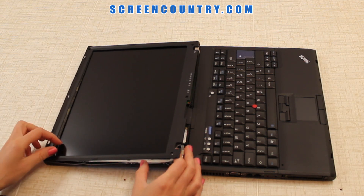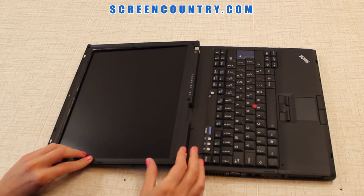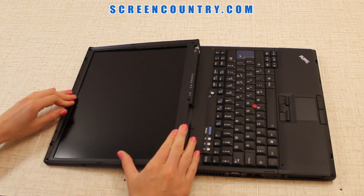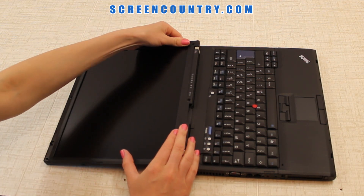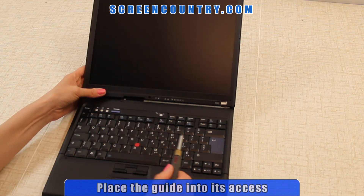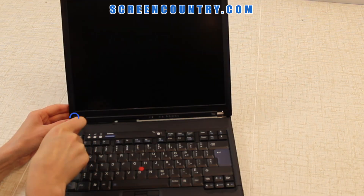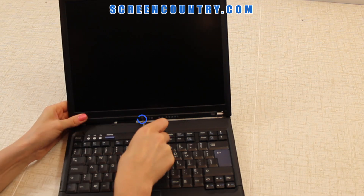Start on the side and gently snap around the perimeter. Leave the bottom edge unsnapped to align the video cable guide. Use a screwdriver to snap the guide into its axis. Now replace the 3 large bottom screws.